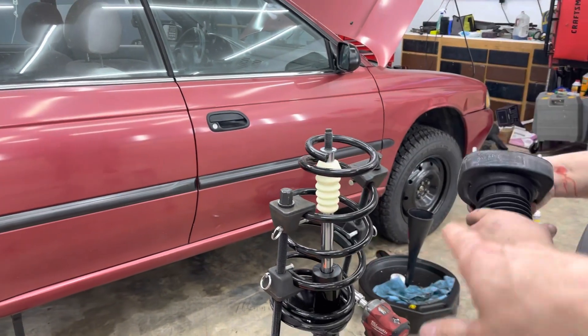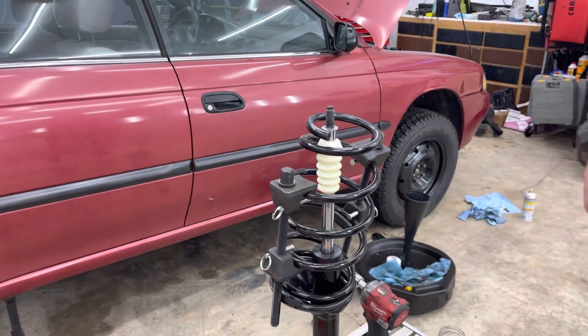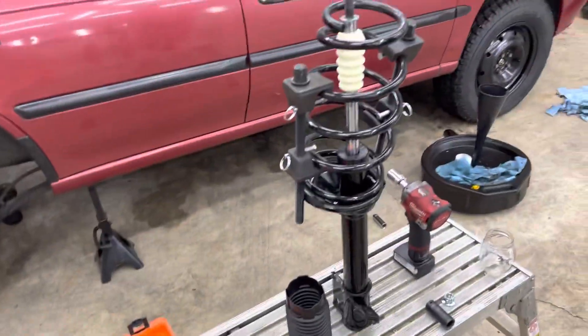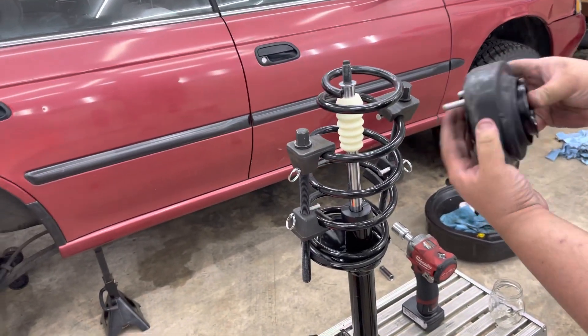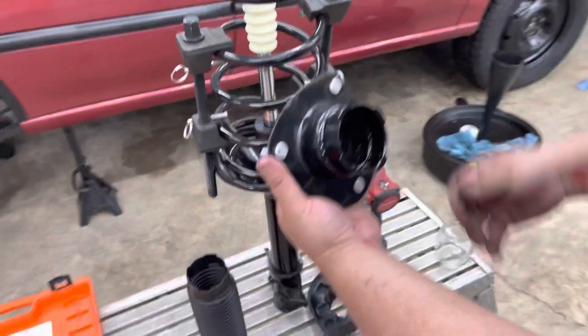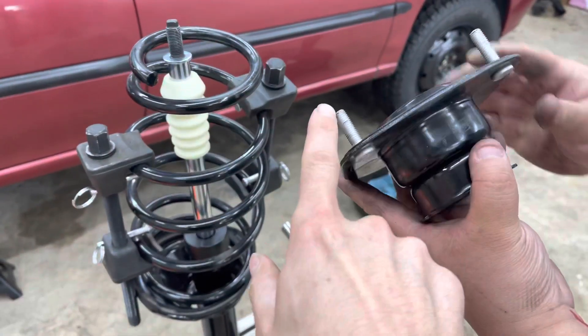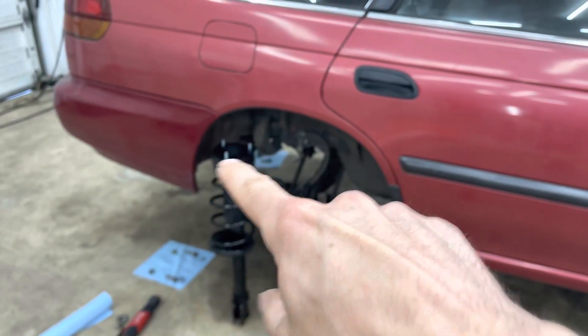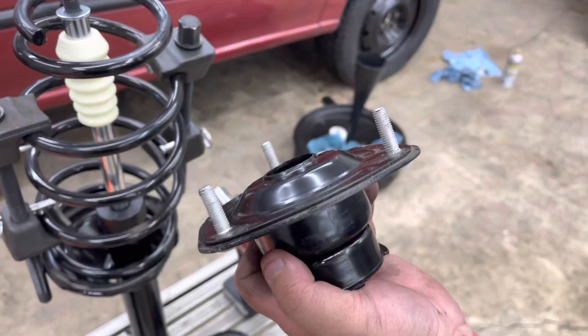On a Civic I've done it without a spring compressor, which was pretty sketch, but I'm glad we got this spring compressor. We actually got it from AutoZone — you're able to rent it and then you get all your money back if you bring it back the same day. So he's got that little piece off in there. Now we've got to pop these out and then we're going to put in the longer bolts with the spacer there. So it's pretty straightforward — we just got to hammer on them.